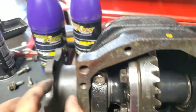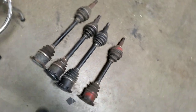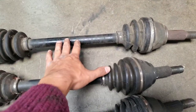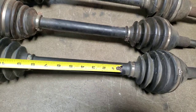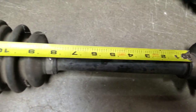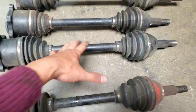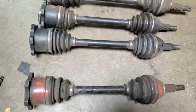These axle stubs — the flange differences are all the same, so now I need to make up this extra room with axle changes. I ended up with a 300ZX that I found and I've been saving, hoping to sell it someday, but now's the chance to actually use it. This one is going to be 11 inches, and then the 11-inch is off a Q45. This is going to be a nine-inch off the Q45. And then the last one — 300ZX — it's going to be a seven and three-quarter inch axle. That one's definitely going to the driver's side because it's short. To run the Weir setup, you need the 300ZX twin turbo axle — you can find them on eBay a lot easier than in the junkyard, but they're pretty much impossible to find in junkyards.